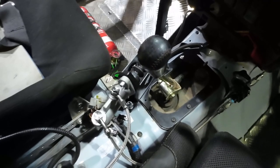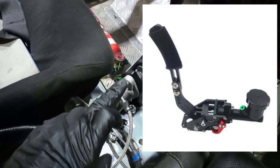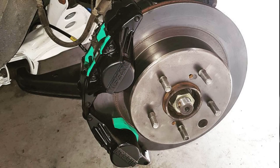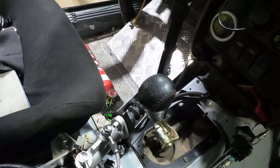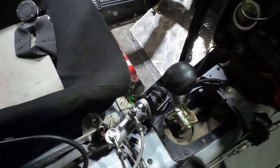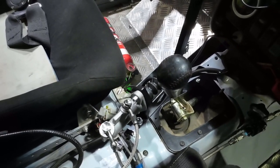There is another way to fit a hydraulic handbrake. Instead of an inline master cylinder, you can get one like a trailer master cylinder that has its own separate reservoir with one outlet going to the rear wheels, and a separate set of brake calipers fitted to the rear wheels. From our point of view we don't like having fluid in the car - a reservoir inside is not ideal, particularly if there's a rollover and fluid spills everywhere. Secondly, it means adding complexity and fitting a second set of rear calipers and double sets of brake pads. Instead, our setup sends fluid to the factory rear brake calipers already mounted in the car.